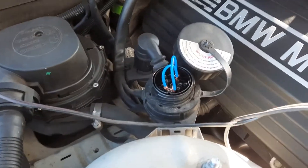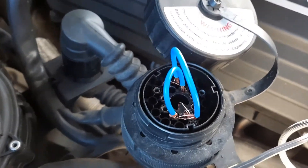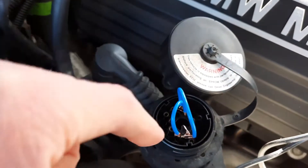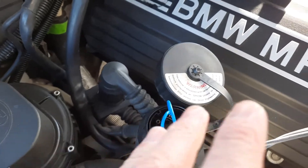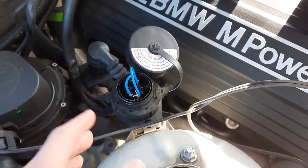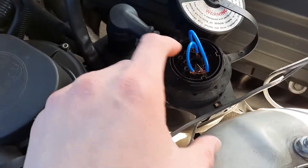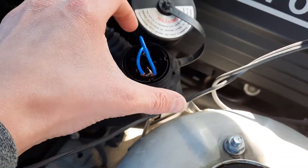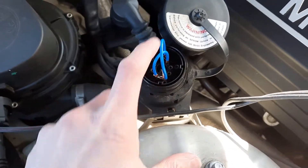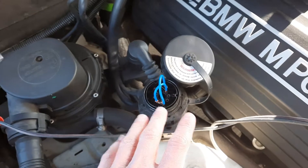In this connector, you have to connect pins 14 to 18, and pins 2 to 17. This looks a little messy — I'm going to fix it — but that's the general idea. You need to make sure that these stay in the whole time the ECU is flashing; otherwise it just won't work. It won't damage anything, but it just won't flash, and it'll be very annoying because you'll have to do it again. Pin 14 to 18 puts the ECU in write mode, and 2 to 17 bridges your OBD2 connector to the ECU to make sure that it can actually read the flash.